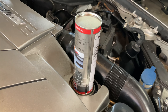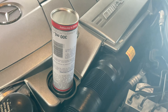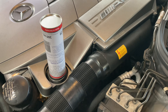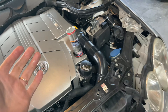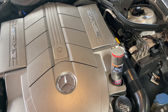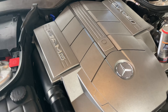I'm adding in one bottle of the Liqui-Moly Motor Oil Saver — it has really good reviews. It was really thick, kind of like magic oil, and it has a fluorescent hue to it. It says it treats up to five liters of oil. I put the other bottle in too — might as well, since five liters wasn't really going to be enough for the nine quarts that are in here. I've heard from other C55 owners who have tried it and had success, so it's not going to hurt anything. These cars are designed to burn some oil, but we'll see what happens.